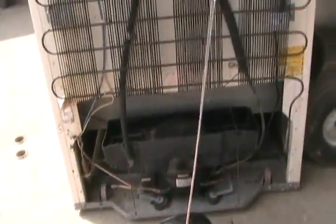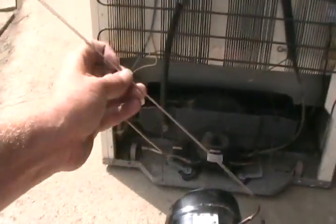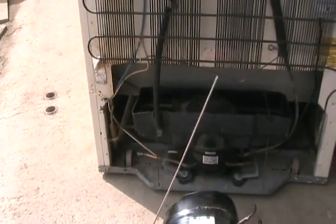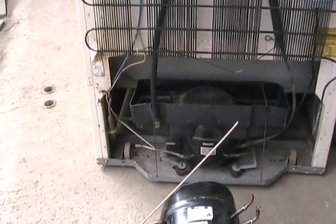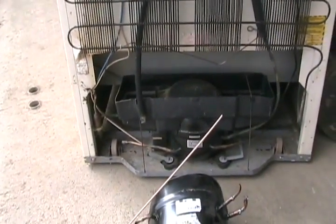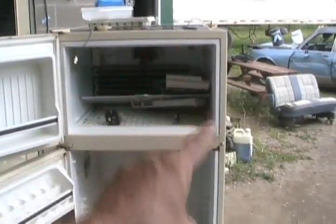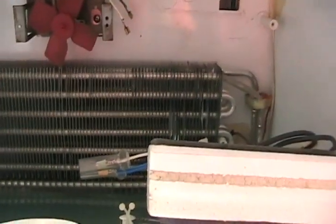All leaks on the outside and back of the fridge are very easy to fix with a piece of Silphos or silver solder and paste. Silphos works best — a stick costs about two dollars. It doesn't need any paste or special preparation as long as the tubes are fairly clean; you can just weld it on. You definitely need a high-temperature torch — a regular propane torch won't work. In most circumstances, though, the leak is around the door frame, so good luck fixing that.